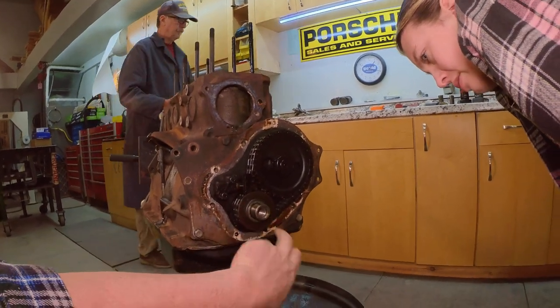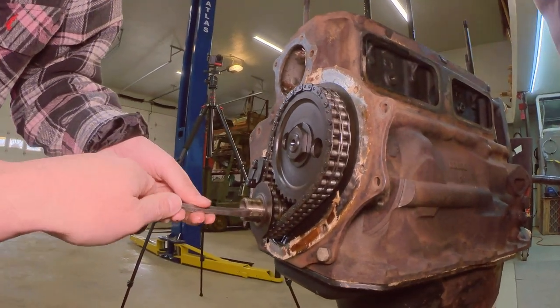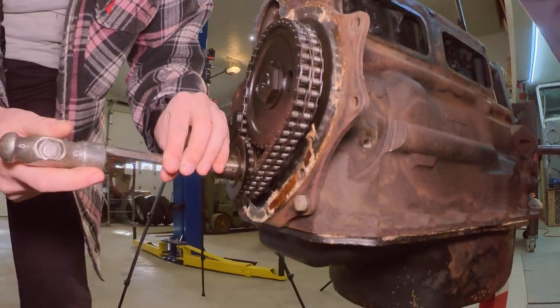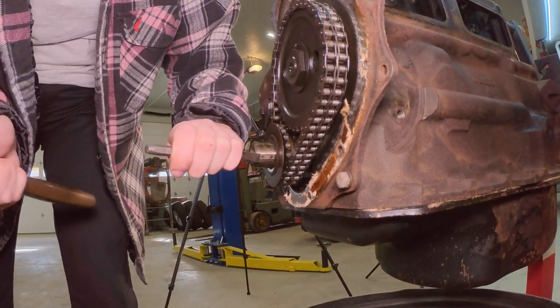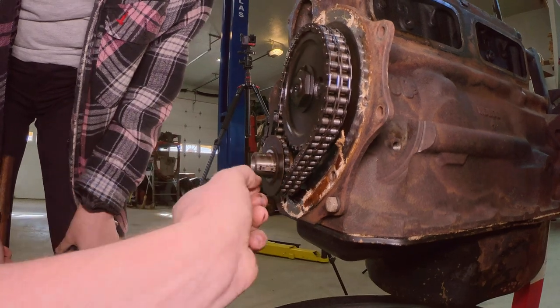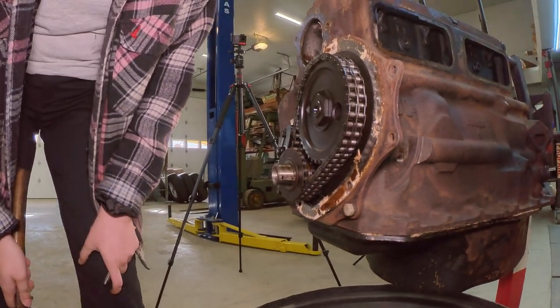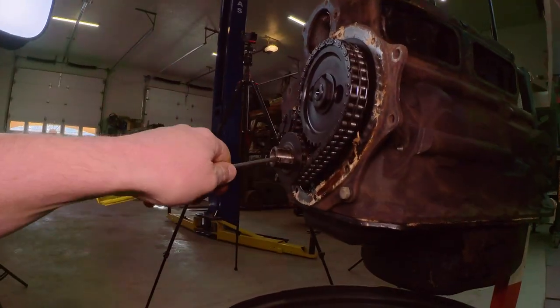You get that chisel that you had. You put the chisel just right in there, and you hold it at an angle like that, and then just tap. There you go. Careful, careful. You don't want to drive it into that. Now that little screwdriver that Grant had might be helpful. Yeah, this thing right here comes in handy. So this is called a Woodruff key.